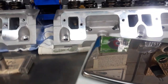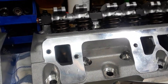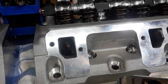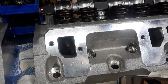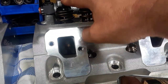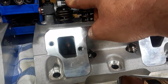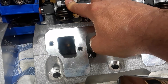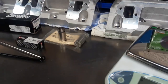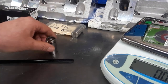Basically, when you're building an engine and choosing valve springs, it's based on overcoming the inertia of the components you're using. A lot of people just think you're overcoming the weight of the valve — well that's only part of it. You have to overcome the weight and inertia of the rocker arm (aluminum ones are lighter, stainless steel are heavier), plus the weight and inertia of the push rod, and the weight and inertia of the lifter.